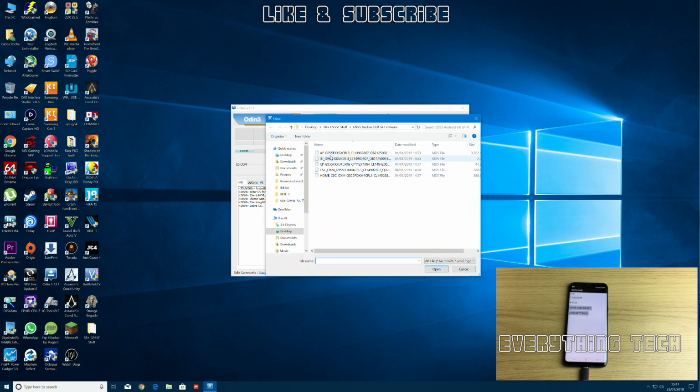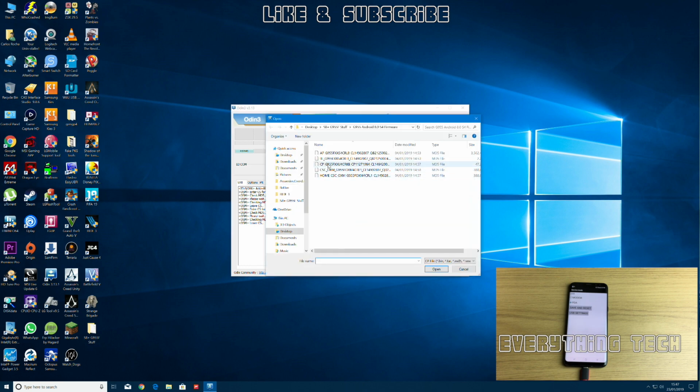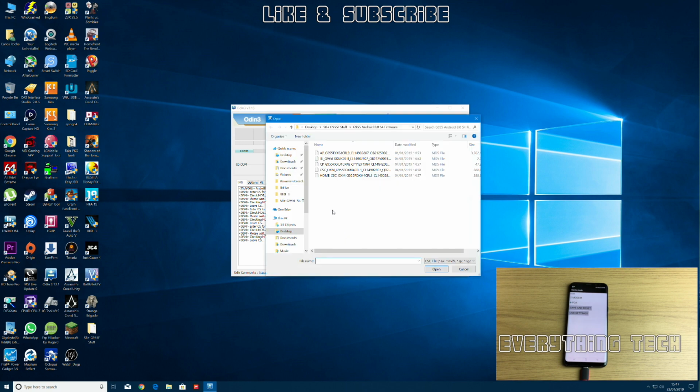And AP, just be aware that it takes quite a bit of time to load, but I've sped up this part, that's why it's loading a lot quicker. Then once AP is in, it's time to load CP, which is your modem, and finally CSC. Instead of CSC, just select home CSC. That's what you need to select.